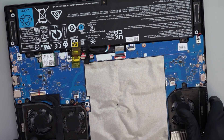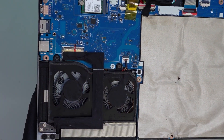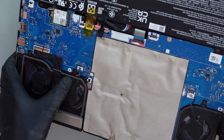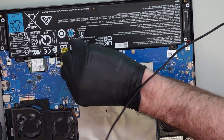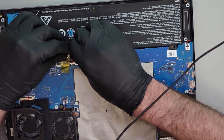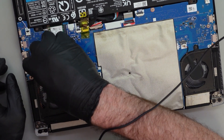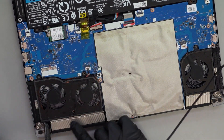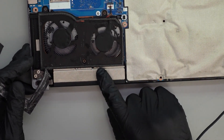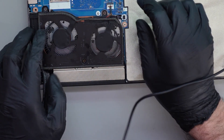Okay, so this is actually pretty dangerous — you can see there's a little bit of damage here to the heat sink. It looks like it's lifted up a little bit here. Let's unplug the battery — you can even see the battery tape isn't perfect. Let's open this up and see what's going on. The tape looks to be okay, but let's unplug this. Let's take out the display cable — you can see there's a little bit of struggle around the heat sink.